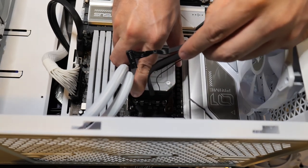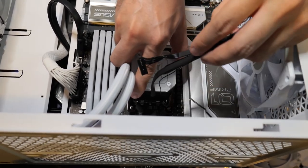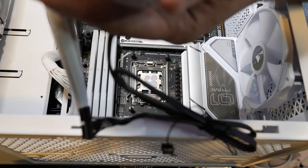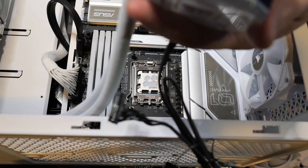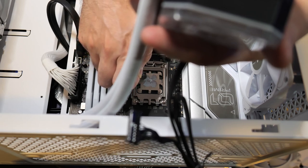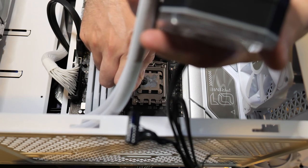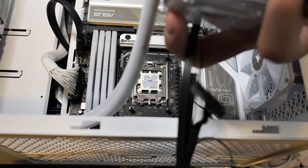What I'm going to do is wiggle this around a little bit here, like that. You guys can see that. It's okay to lift this up and see what kind of spread you have. Now, that looks like it's too little. It doesn't look like there's enough thermal paste on here. There's a little bit on the heat sink, so we're going to add a little bit more here, as there's not enough coverage. I will tell you when there's enough coverage from experience. I put a little dab in the center, not a lot. I prefer to put little teeny dabs here and there, put a little bit there, put a little bit there. Not a lot, you don't want to do a lot. You just want to take your time doing this. You don't want to do a whole bunch of it all at once. There's a little bit here and there, right? In the center, even that little amount that I put looks potentially too much for me, but...